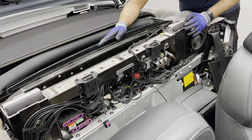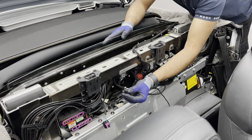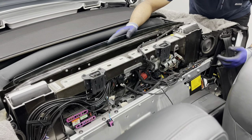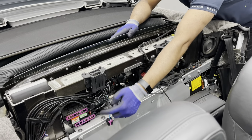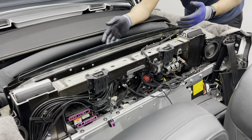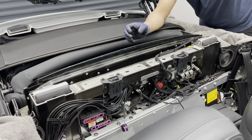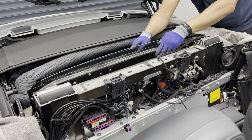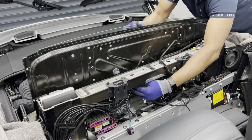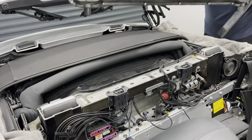So just to summarize: we've disconnected the wiring — the demister wires are loose, the hall sensor is unplugged, the motor is out of the way, and we've removed the four bolts — one, two, three and four. Remember to mark those bolts so you know the relative position of the window cartridge. To get the cartridge out there's a drain over here and a drain over there — it's a plastic pipe in a rubber sleeve so you might have to give that a bit of a wiggle. Let's pull that and the cartridge comes out — feed your wires through, and there's your cartridge — it's out.